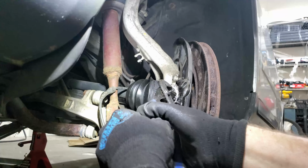They are four piston Porsche, by the way. Let me see if I can turn on the light for you. I believe they're from the Porsche Boxster. I thought they were six piston. That's what the kit that's available on ECS Tuning is, on their website right now. However, I don't see six pistons. So I think back in the olden days when this kit was purchased, they were using Porsche Boxster pads. There might be an SUV that uses these as well. Anyway, I now know what pads to buy. I can probably find blank rotors that'll fit pretty easily, and they should be $50, $60, $70 per rotor instead of 10 times that amount.